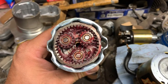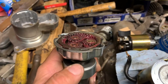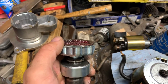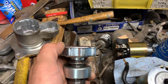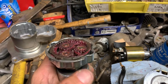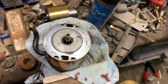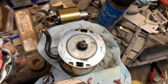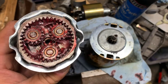Use a little bit of Red Mystic grease. This outer ring gear will only go one way — if you put it in the other way, it's going to stick up past this silver cup piece here. It's got a machined area that makes it sit flush. If you go to put it back together and it's sticking up past here, you've done it backwards. Then your planet gears just go in like that and sit on that piece, and the long bolts will go through.